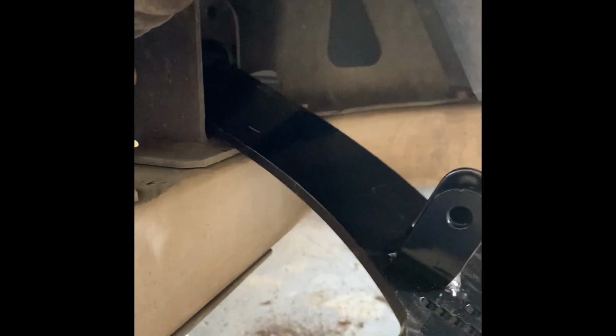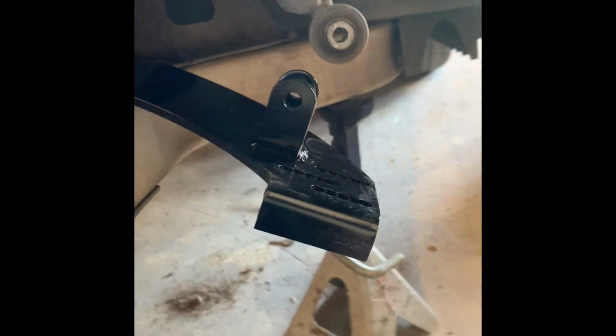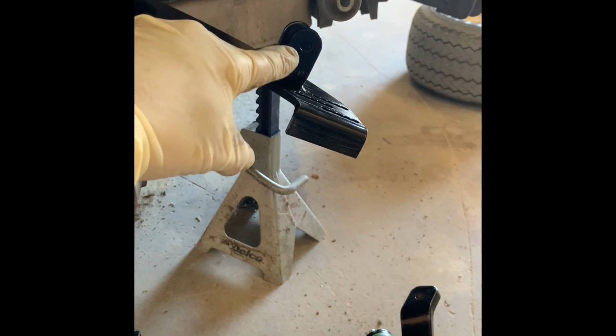So I saved these 2 for the new A-arms. So we're going to slide them back for the A-arm was before. Okay, got the A-arm in. So basically you just put it right through here. You line up the hole, zap it down. Make sure it's curving towards the front. And the reason for that is because you need to bolt your shock back into there.